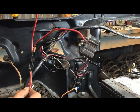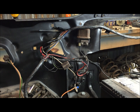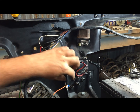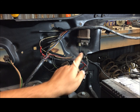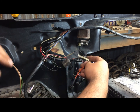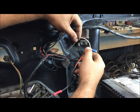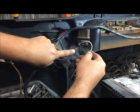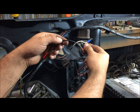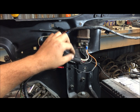Take wires 2 and 3 out of the plug. This is another harness — you can see the mass splice right here and we just clip that wire off. Since 2 and 3 had to be jumped: this is the white wire going to the number two position on your alternator. We just ran it back over here to the bus bar on the horn relay — 12 volts from the battery. A lot of times you see people jump number two straight to the lug with the bolt on the back of the alternator — I don't like that. So I ran this wire from number two and connected it back right here. This is the lead to the amp meter — I just combined them to clean it up. Now we've got it basically hooked back up.